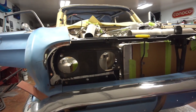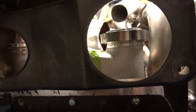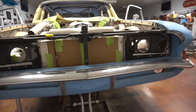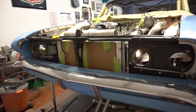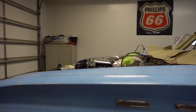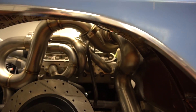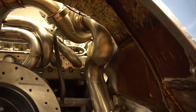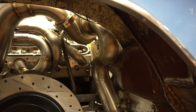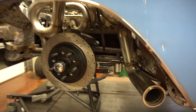The v-bands have a little neck on them, so it doesn't gain a huge amount but we're still trying to gain everything we can. It's also a more positive connector and gets away from all the rubber couplers. The down pipes are all built and mounted, and the bungs are already in for those two sensors on the back side, right where they meet the frame rail.